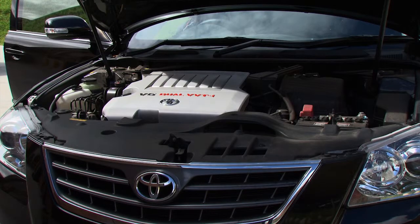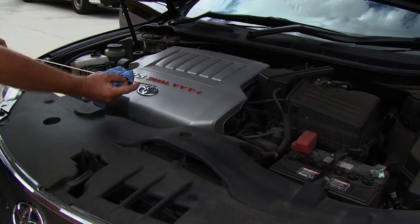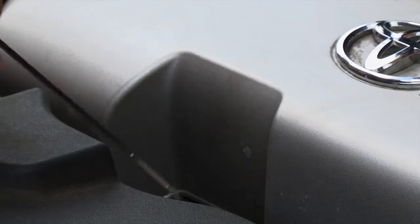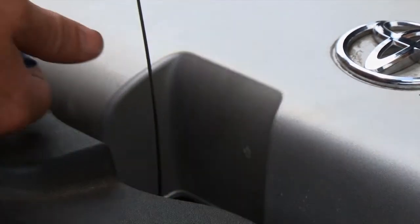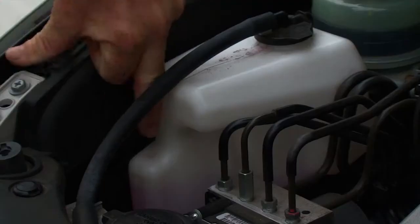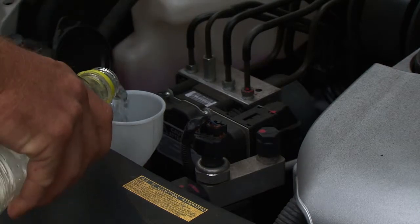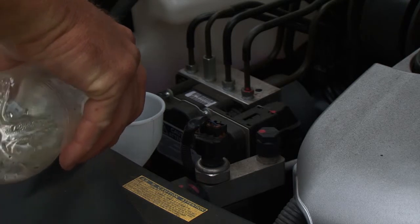Please consult the car owner's manual to get information on the vehicle's under-bonnet layout and basic maintenance instructions. Inspect the oil by removing the dipstick and wiping it with a clean rag. Reinsert and remove again to inspect correct oil levels — the oil level is acceptable if it is at least halfway between the low and high marks on the dipstick. If the level is below this, record it as requiring attention. Inspect the coolant reserve bottle is showing between low and full; if the water level is low, fill with water, but have it thoroughly checked at a workshop in case of radiator or hose damage.